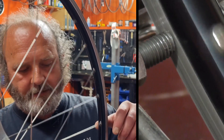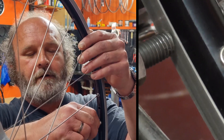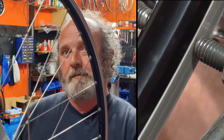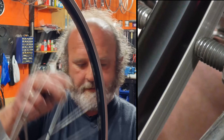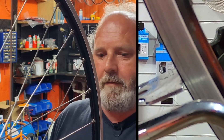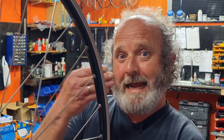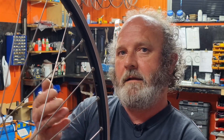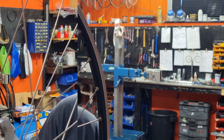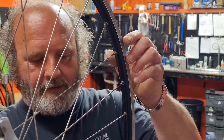After loosening, it's still there. Working just on two spokes — loosening them — they start to disappear. But now it looks like the buckle has reversed — it's going the other way. Looking at the roundness, it's no longer round. What's happened is the rim has been let out because we loosened the spokes, but we haven't counterbalanced that by tightening the other side to keep the wheel perfectly round. Let's pull that back and start again.